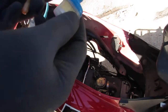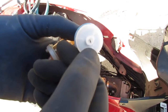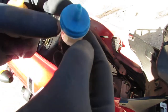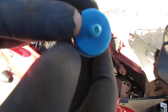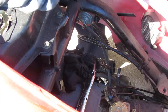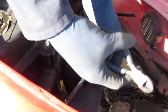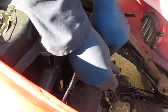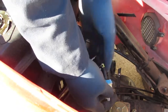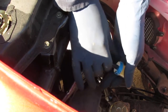Here's our old fuel filter. The gas came in from here and exited down here. They wrote the word 'flow' on it with an arrow. Our new filter doesn't have that. If you look up inside there, it's all open, so fuel is going to collect at the bottom. That means fuel has to come in, get filtered, before it goes to the carburetor — so this will be the upside. I'm going to cut back this fuel line to get past the cracked section.